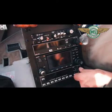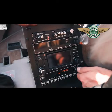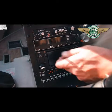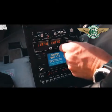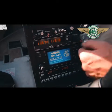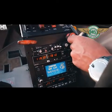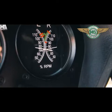You can now switch all of your avionics on, starting with your transponder. Check it is set to 2600 for helicopters and move it over to mode Charlie. Switch your GPS on and your radio on, and check the frequency for the airfield you are at. Check the volume as well and you can place your mixture guard on. Prior to doing the magneto test, check that all of your engine T's and P's are in the green.